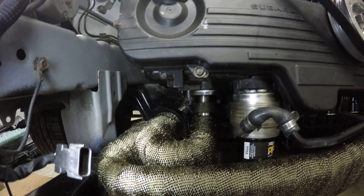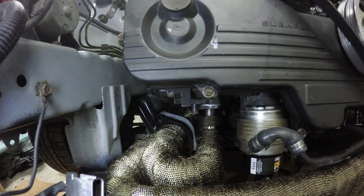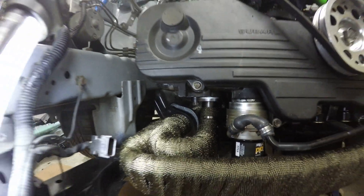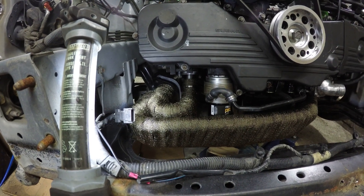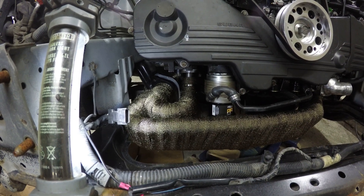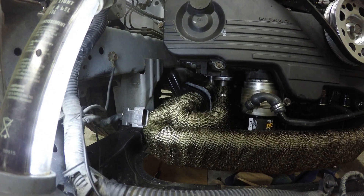One last thing — up in the back there you can kind of see how the up pipe sits. You can just barely see the flange of it there, and the pipe is so big that it still wants to hit the cylinder head. I already know it needs to be adapted and it's gonna take a little bit longer than the header. I may need to order some stainless pipe. I think I am gonna reuse the flange and not bother with a v-band because there seems to be plenty of room to bolt the pipe on and off.